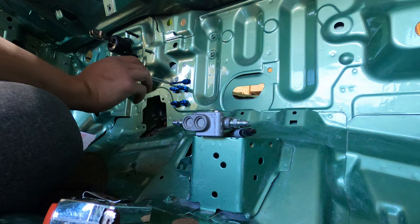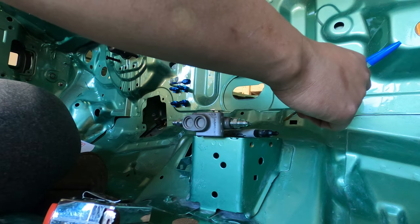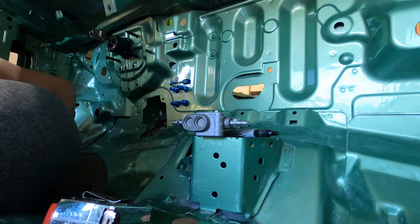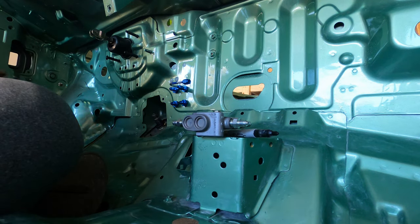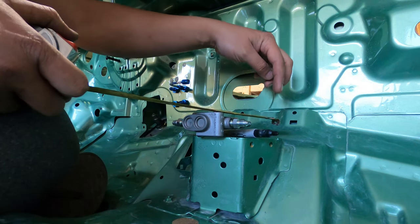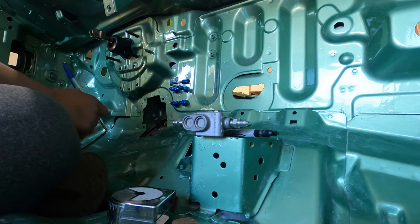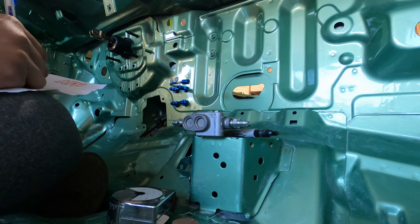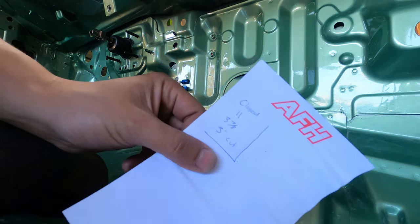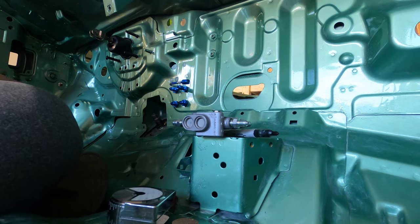Precise. So we got the closed bend, 11, 3 7/8. And then after that, we're gonna cut it. That cut, we're just gonna give it a rough estimate and then cut it to length. So it's gonna go over here, down. I'll give it 3 inches. So I'll do a 3 inch cut. And that'll be our first line. So I'm gonna go ahead and bend it and see what happens. Oh shit.